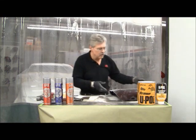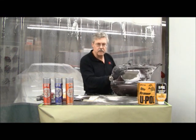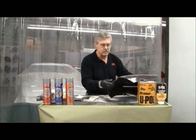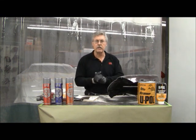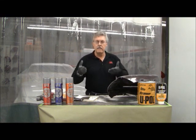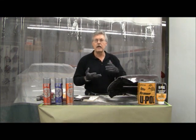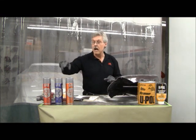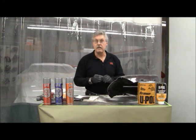At this point I'll let this set up again and come back in to block this out by hand because I put a very, very thin skim coat of material on there. So that gives you a short overview of how you use the 706-1 flexible high-density filler. It's one of the many products that UPOL manufactures as a high-end, cost-savings alternative specifically designed for the body technician. We're a European manufacturer — all of our products are made in England, brought here to the United States and distributed throughout North America: Canada, the U.S., and Mexico. Generally, any of our products can be found at suppliers selling you your paint, your supplies, or other products you're using on a regular basis. If you've got any questions about this filler or any of the other products — the Acid 8, High 5, Clear Number 1 — you can contact us on our website or phone our office at 800-787-5150.